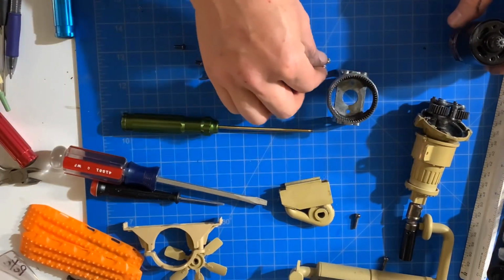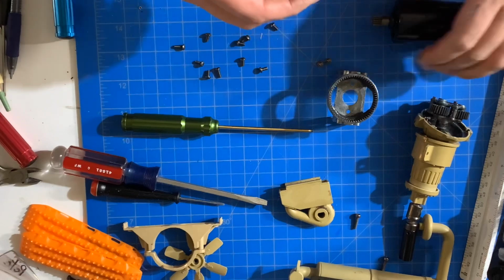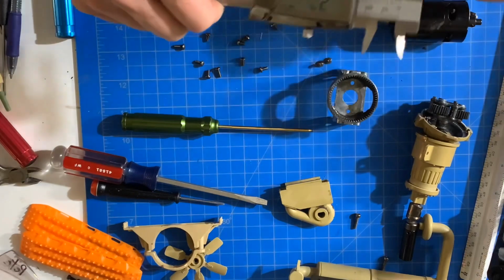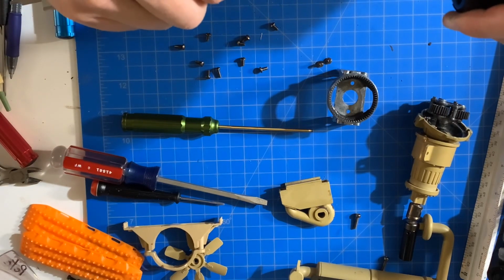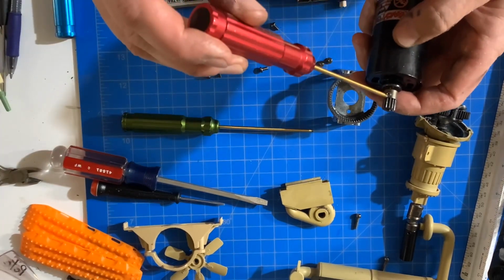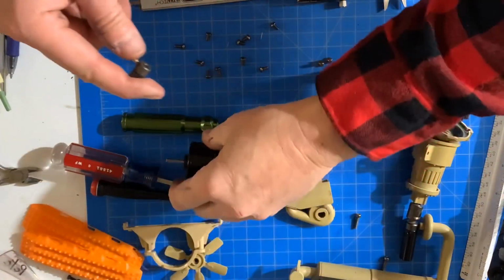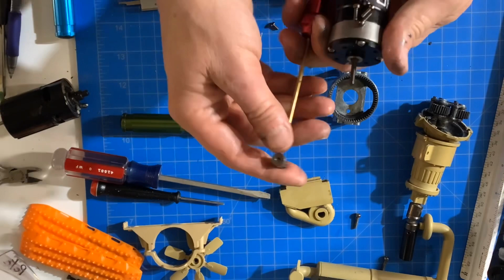Let's put our pinion on first. Okay. So we want to put our pinion in the same location. So we had 36 to the back. We already checked that was going to be close. So here, we want that out at 19 mil from the motor. Bam. All right. Let's see how that fits on here. Oh, look, more screws.